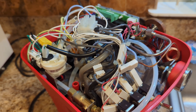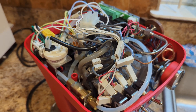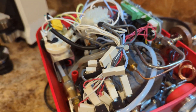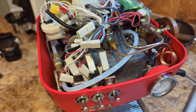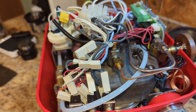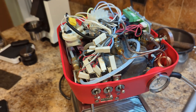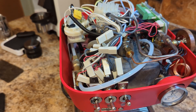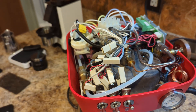I'm going to call this thing good to go for now. Until further testing shows I'm going to continue having flow problems, it looks like reseating that connection corrected it. I'm surprised it seemed as simple as a loose connection, but I don't see any other obstructions, and a quick test shows me building more pressure on a faster shot than I have in the past few days. Mostly this video was just an excuse to look inside the top of this machine at the way it's built - pretty interesting. Very good engineering on the layout; it's super compact.